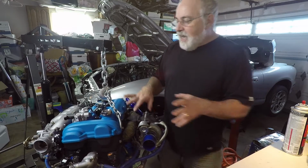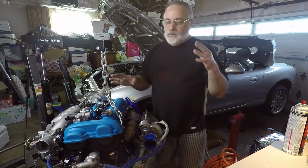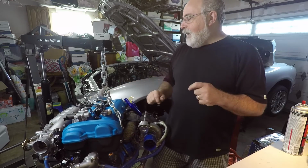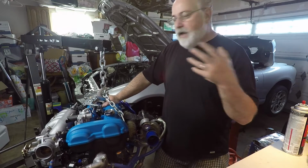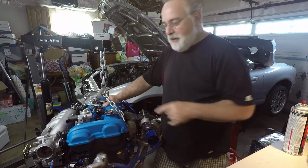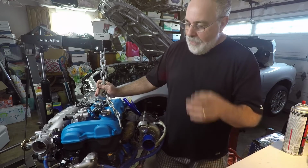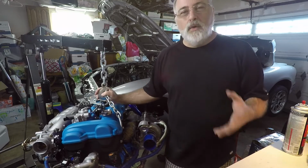It's just not a lot of flow is going through the back of the engine, and as a result the number 4 cylinder can get a little hot, and some people report that the number 4 cylinders get burnt, valves get burnt, rings go bad. There seems to be a lot of bad things that happen at the back of the Miata motor. So the community decided to come up with a solution. Somebody said, hey, why don't we just restore the original coolant flow? And that's what a Coolant Reroute does.